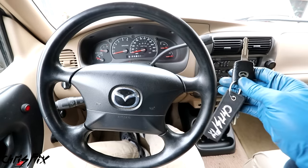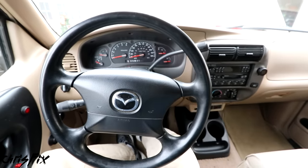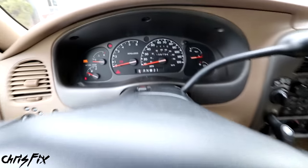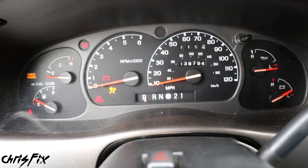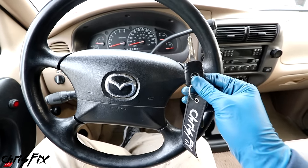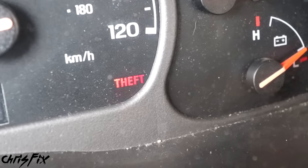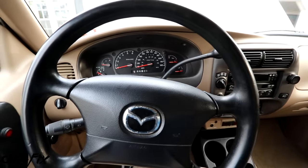Another common reason is the anti-theft immobilizer. Many cars today have chips in the key which will prevent somebody from hot-wiring your car. If this immobilizer goes bad, you go to start your car and it won't start. To tell if the immobilizer is bad, go to the dash, put the key in the run position, and look for the anti-theft light. After a few seconds it should go out if it's working correctly. If the immobilizer isn't working, it'll stay lit or flash rapidly.